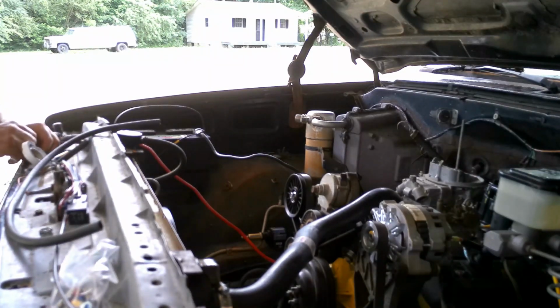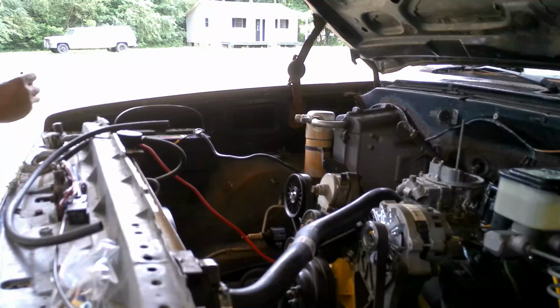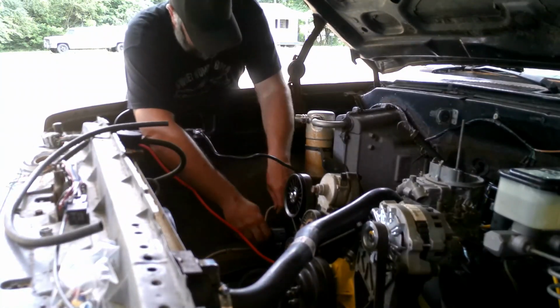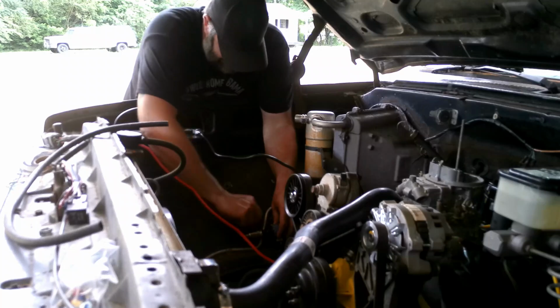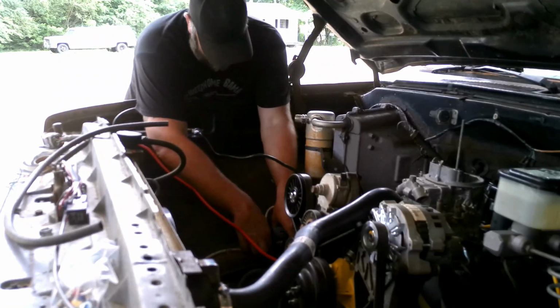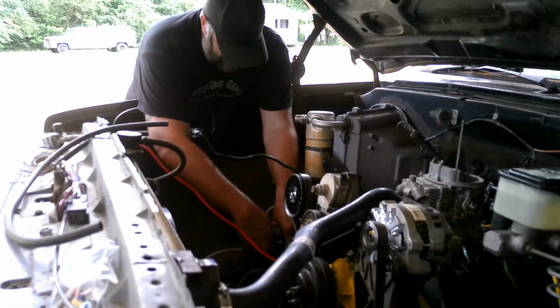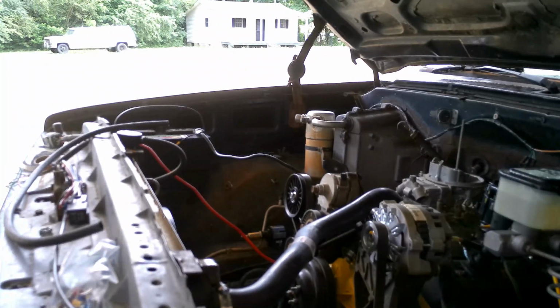even though I already got the nuts on the other side, we can just go ahead and pick that pump up, stuff these underneath there, tighten the bolts down, and then we'll have an absorber, so to speak, in between the pump and that inner fender. And it should cut down on the noise a little bit. Alright, I think that's going to work. I'm going to go ahead and tighten those down and we'll start running our fuel system.